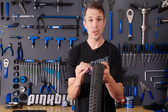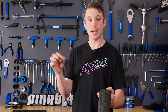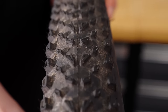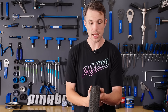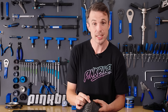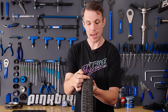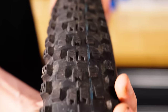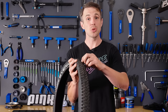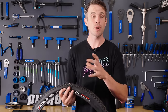As a general rule of thumb, the shorter the knobs, the faster the tire will roll — but it comes with a cost: it will also be significantly worse at braking. To try and recoup some of that traction lost, the tire actually has far more knobs. They proliferate the whole tread and are very specific in what they do. You might even see, for instance, that the leading edge is actually stepped to take away resistance under acceleration, but with a flat backside to give as much braking as possible. For a lot of us not riding really loose, aggressive trails, a cross-country tire can provide loads of grip — those shorter knobs squirm less, and with so many of them, they can sometimes take to the shape of the trail better.